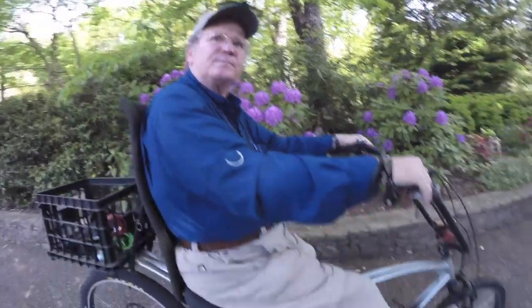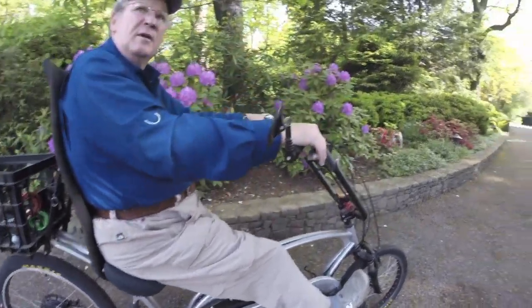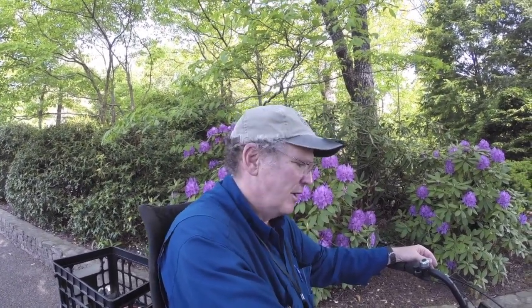Yeah, and that's a good point. It didn't seem like the battery was especially removable on this, but given the size of it, the distance that you can go, and a charge time like 6 or 7 hours, something like that. Look, I've never run out of battery with this. I plug it in and use it the next day, so I presume 6 or 7 hours. In mountain riding, going to lunch and back, with a 600-foot vertical rise, pedaling hard, I get about 45 miles comfortably on a charge. And again, I've never run out.